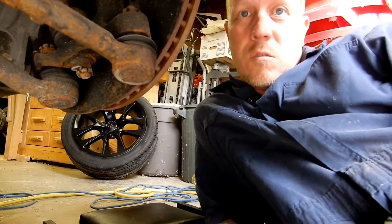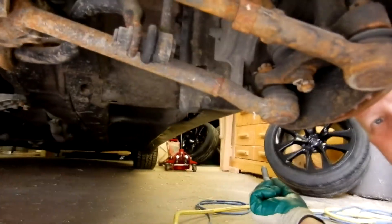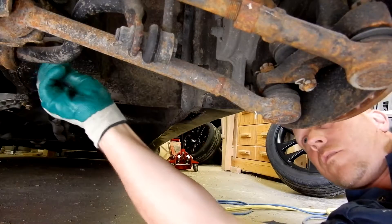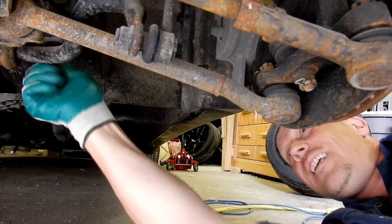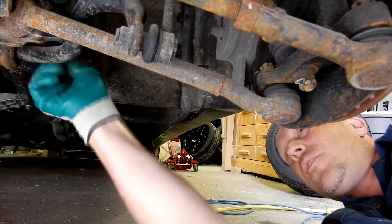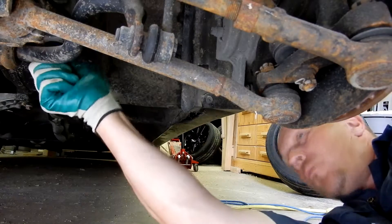Because this is a fine thread bolt, do not use an impact wrench. Wrench it in nice and snug, then move on to the next one. Put it right here and screw it until you can't screw anymore, then use your wrench.